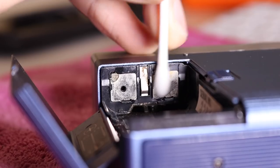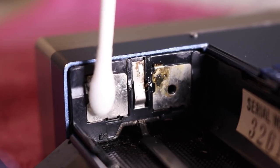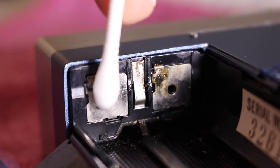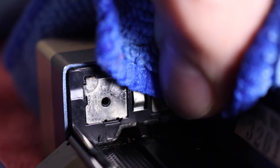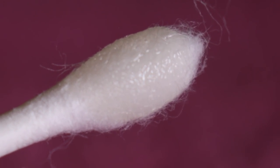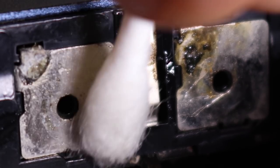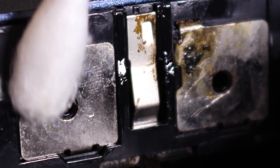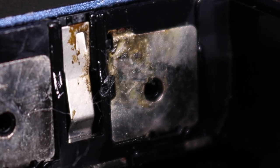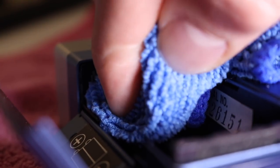One of the other things that needed to be done was to give the battery contacts a good clean. I'm not entirely sure how you can take these out other than to pry them. I took some isopropyl alcohol and started giving it a rub down, but that just didn't seem to work at all — there were some really stubborn blobs of corrosion that weren't coming off. I took a little bit of oil and coated the battery contact. You can see on this zoomed-in shot some sort of build-up. I took a little scraping device — that's why the oil was there, just in case it scratches — and then gave it another wipe down. I was pretty happy with how it ended up, definitely better than before.